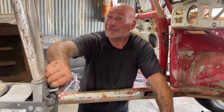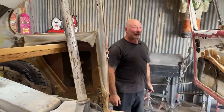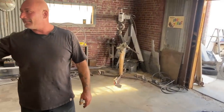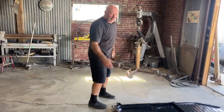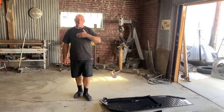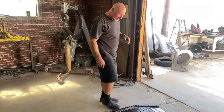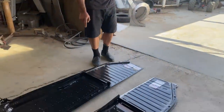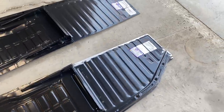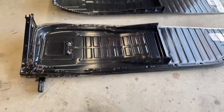The bug is a little bit too small for me to get in there. Let's discuss the floor pans - I just drove down to Los Angeles to pick these up. Anybody in the Volkswagen world knows MPI; they've got a massive facility down there. I bought these online but I mentioned they don't really want to ship them because they're sharp. I went in anonymous - I wore that mask that makes me look like Jim Carrey so they didn't know who I was. They're direct replacements, proper year - got the seat tracks and the little jack port. They're pretty light gauge and I've heard different reviews: some people said the bolt holes don't line up on the rockers, some said they required trimming. I don't believe any of that until I see it - we're gonna try it right now live and direct.